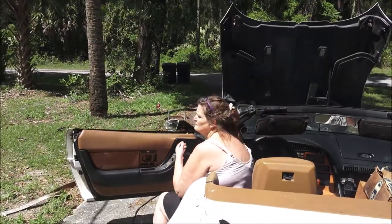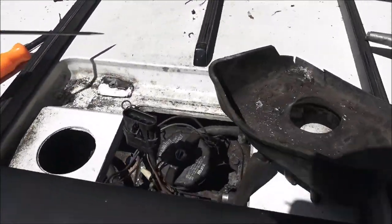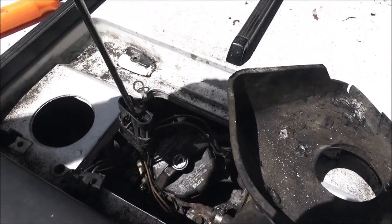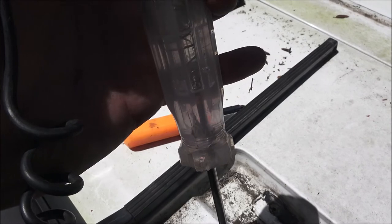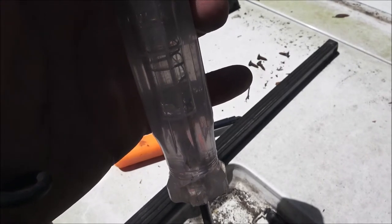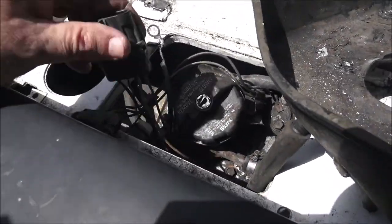Okay guys, I've got Monkey here to give me a hand. I've got my test light grounded onto the trailer hitch. I think the brown and white wire should be positive, so it should come on for at least two seconds and then go out. Alright, let's see - go ahead Monk, turn the key on. Okay, it's on... it went out. Shut it off. Do it one more time. It's on, it should go out - and there it is. I've plugged this in - thank you Monkey.